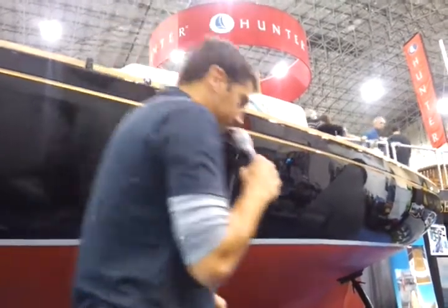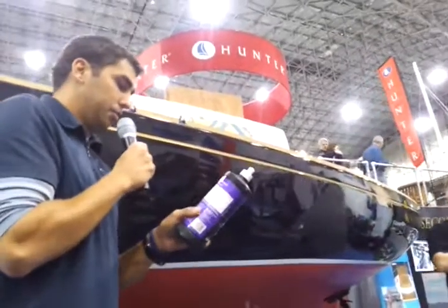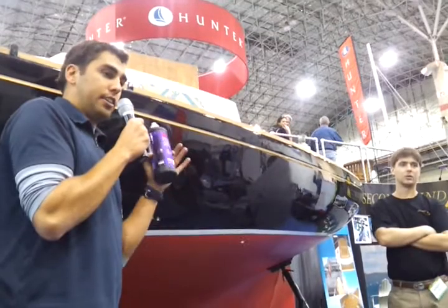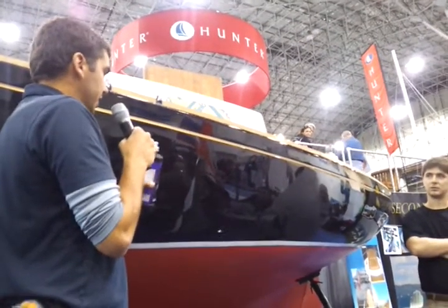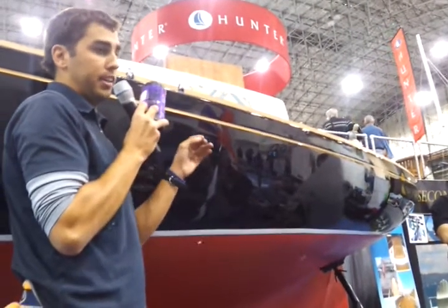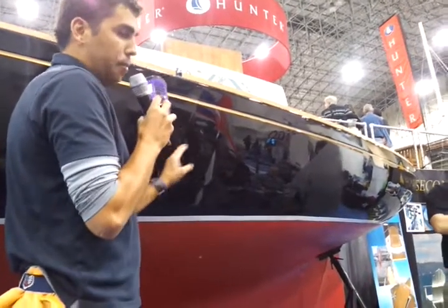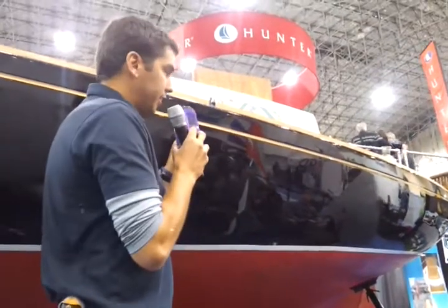So these products, the Imperial, for one, starts out at 600 to 800 grit. And as you're working this, it's diminishing. So imagine you've got a piece of sandpaper with the big grit, you start sanding it, you're getting out the deep scratches. As you work it, these little silicone beads are rubbing and breaking themselves down slowly. So the beads get a little smaller, and that's going to polish out more scratches, give it a higher gloss, and it just breaks down until you saw that just a little bit of oil that I wiped off with the rag.